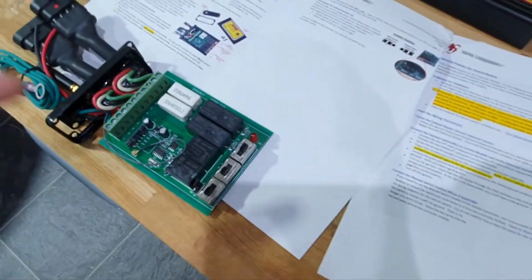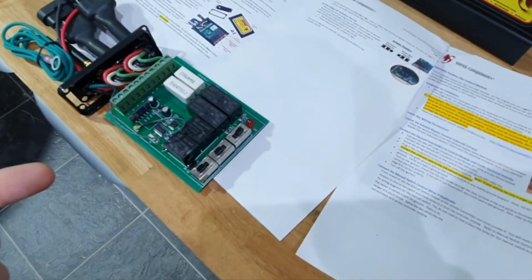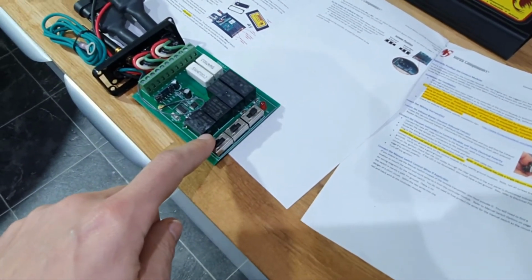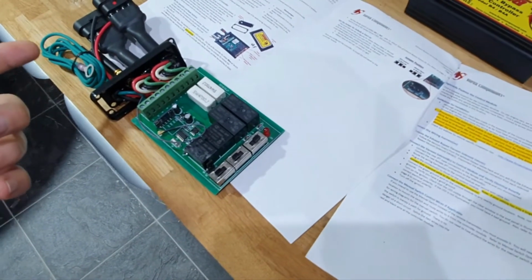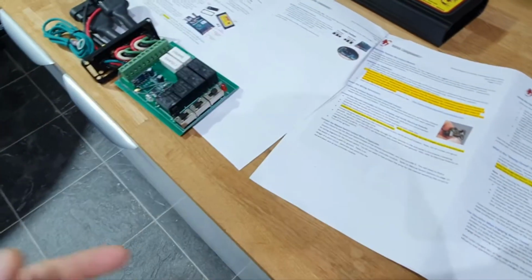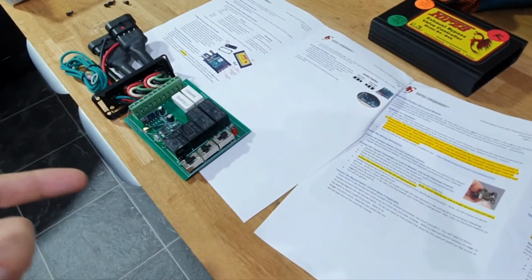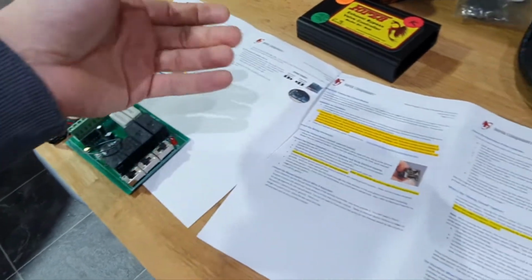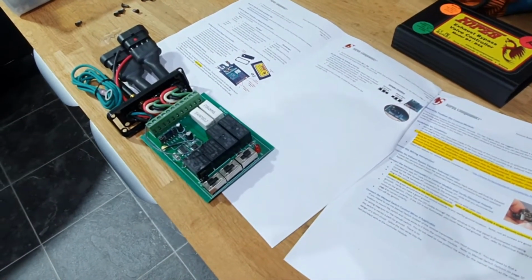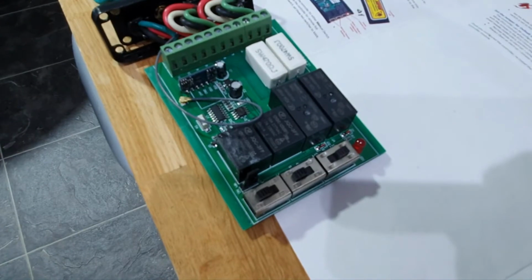But again, this is the beauty of the manual switch. And this is another reason why I want a manual switch instead of a remote: this setting almost becomes irrelevant, because if you have a manual switch in and you've got it switched to closed, then it will just be closed. The trouble with the remote is if you wanted to start the car with a loud start, you wouldn't be able to, because you'd have to turn the car on, wait for the system to initialize, press the remote, and wait for the valves to open. Having a switch just means it's always open or always closed. But it's nice to know that if you did use the remote, you have the option of saying what you want it to be upon engine start.